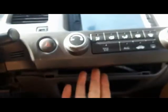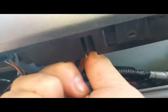There should be a connector through these button assemblies right here. Take it out. I can see a white connector right there. I'm going to push the button and pull this connector out — the button is pretty much on top. You just press on it and pull the connector out. There are two or three more connectors back underneath here, right underneath your radio.